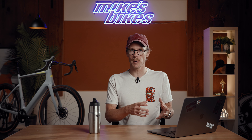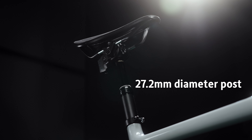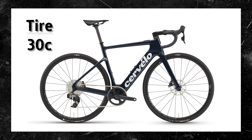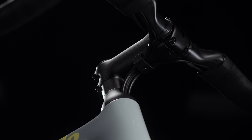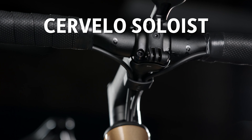Let's talk through some of the other small features on the bike. There is a road and a gravel version — you can switch between both using that flip chip. The bike is compatible with all dropper posts; the spec'd models actually use one of the nice reverb posts that is electronically controlled, which makes for a really clean installation. Depending on which model you buy, road or gravel, you're either going to get a 30C road tire — a normal slick style road tire — or a 40C gravel tire with a little bit of tread on it. You can easily flip between both of those regardless of which version you buy to start with. It's also internally routed, using the clever system from the Cervelo Soloist with a stem that allows cables to easily run inside the headset bearing — super easy to work on, and still allows you to adjust stack height without touching the cables.